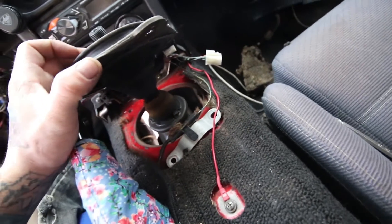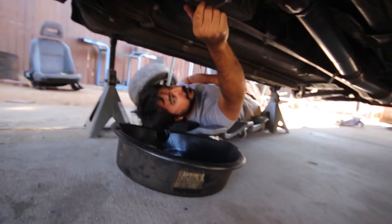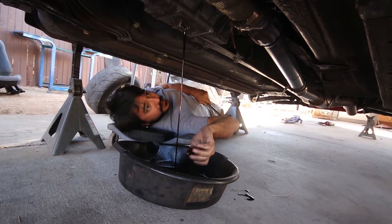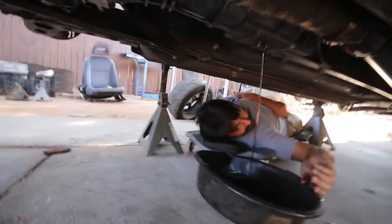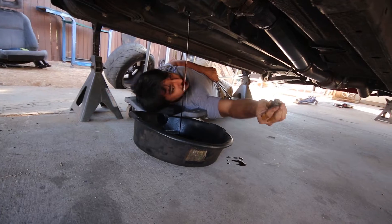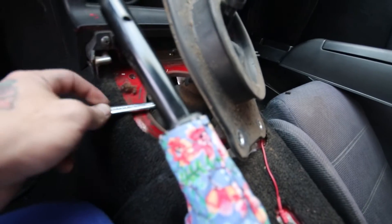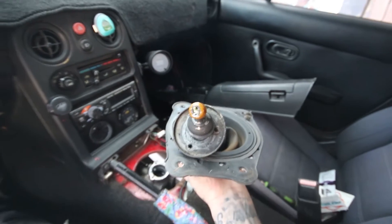There's the turret — just three 10mm bolts. Moving back to the underside of the car: it's a 24mm on the drain plug for the trans. If you've never worked with manual transmission fluid before, rule number one is don't get it on you — it stinks. It looks pretty ready to be changed anyway; it's been in there for six months of hard Arizona driving. Got a little bit of metal on the magnetic drain plug — some souvenirs.